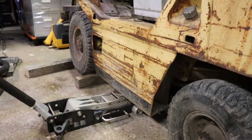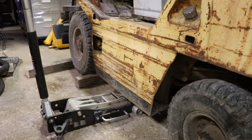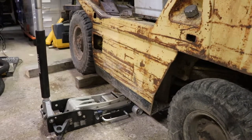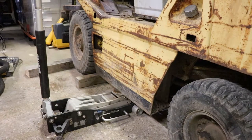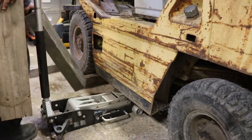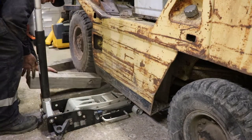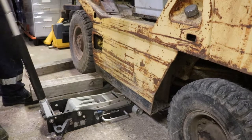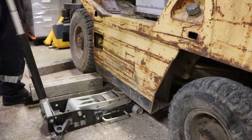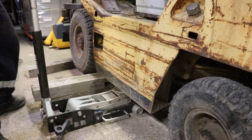This is a three-ton jack. It's quite a bit heavier at the back of the machine, so it's not lifting the whole thing. I'm going to grab a couple blocks of wood. You're not going to find a jack stand for this — you work on these machines in pits or on ramps they can drive up on. These four-by-sixes came from a pallet that was cut up.